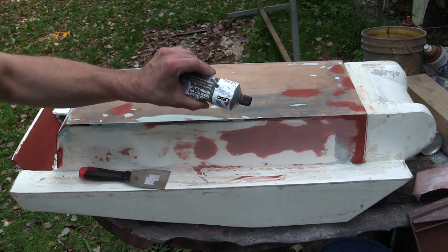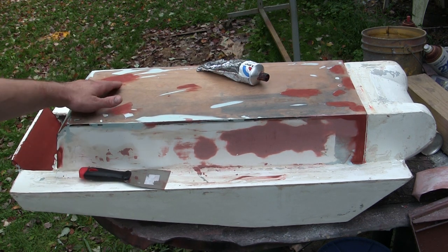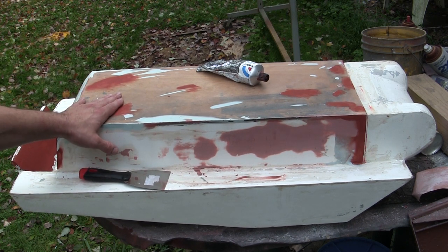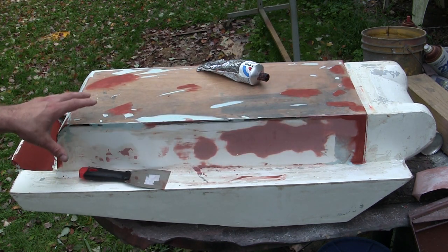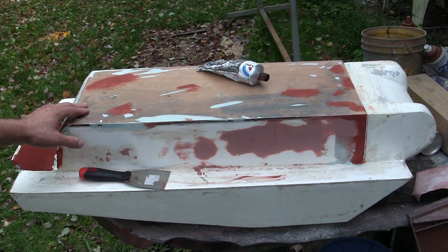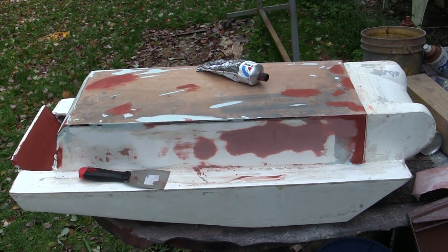Here you can see that I used my red glazing and spot putty on a few certain locations. This was to address some very small superficial surface imperfections that need to be polished away at this time. The difference between the other bodywork methods and this one is, with the other ones I use the palm sander to take care of the sanding work, but for these, since they are so precise, this is all going to be done and taken care of by hand. A few swipes here and there should be more than enough to do the job that's necessary.